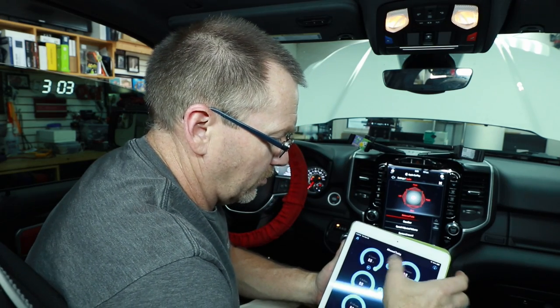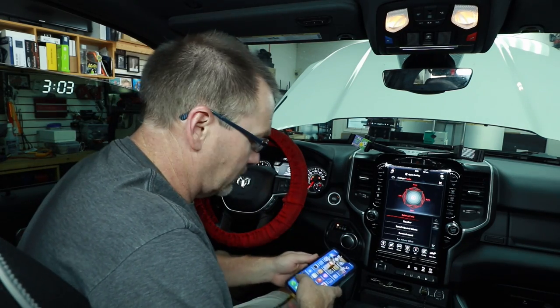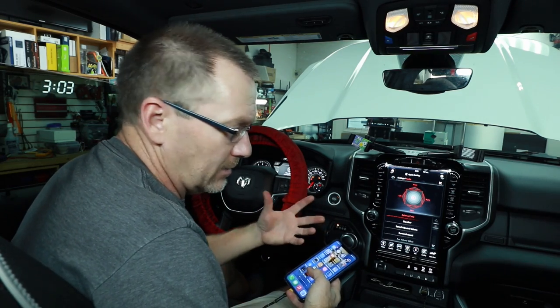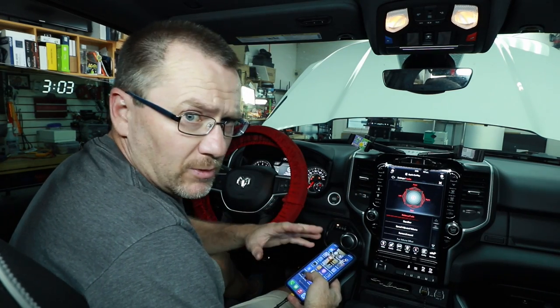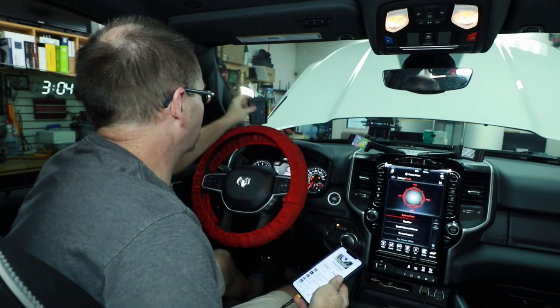That confirms all the speakers are playing on their corresponding channels — exactly what we were hoping for. Next step is polarity testing to make sure all the speakers are moving in the direction we want, just like we did earlier testing the wiring. Now we're testing the whole system — from the radio through the DSP through the amplifiers and out to the speakers. Fernando is checking the passenger side.